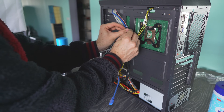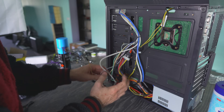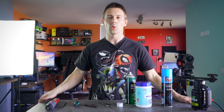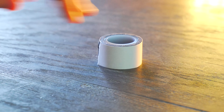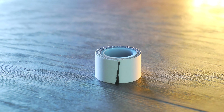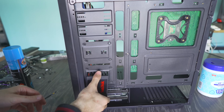Beside that is double-sided tape. I started using this especially in budget cases where the SSD mounting — either the locations or the way of mounting — is questionable. Getting some of this tape is super quick and easy. Slap two quick pieces on the back of the SSD, peel it off, whack the SSD in the back, and it's good to go.